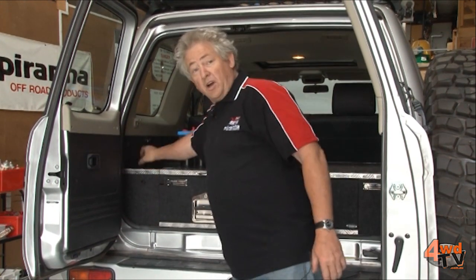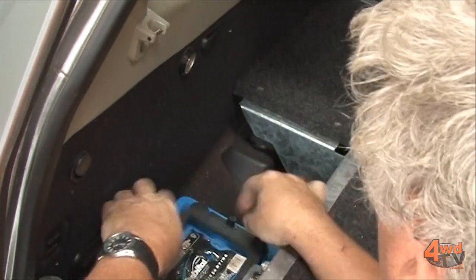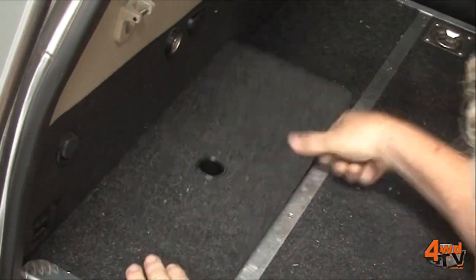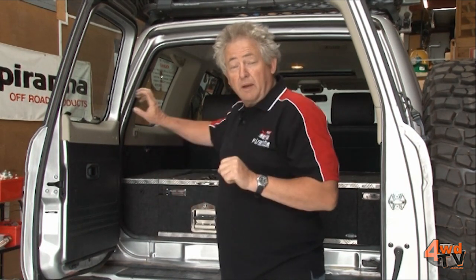Here we are at the back of the car. Now normally you don't always have these wonderful drawer systems but this is a particularly good application. We have a nice little hole here and this particular battery is going to fit perfectly. We can put that sealed battery down in there, put the lid back up on top, and we'll have a whole dual battery system contained in here — with the starting system at the front of the car and the auxiliary battery here. We'll have plugs and sockets for running our fridge, a battery monitor on the dash so Simon can see the specific voltages of both the main and auxiliary battery, and the isolator in the engine bay keeping tabs on both charging systems.